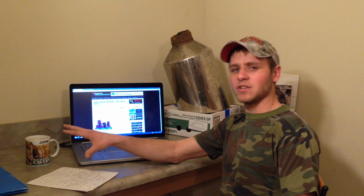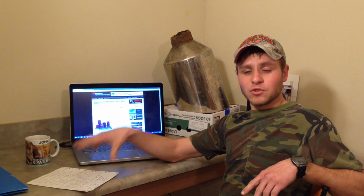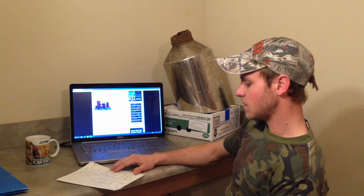Basically, what these guys did was they took a 6.6 liter Duramax diesel and they compared the OEM paper style air filter to a K&N and AFE, along with some other ones of similar style as the K&N. Now, 6.6 Duramax, it's smaller displacement, but it does also run a higher boost, so it's going to be comparable to our 7.3s. However, these guys were also comparing the stock air filters, not anything as large as, say, the NAPA 6637, or with as much capacity as, say, the AFE that I have for the 7.3. It's a really nice write-up. These guys did a really wonderful job.